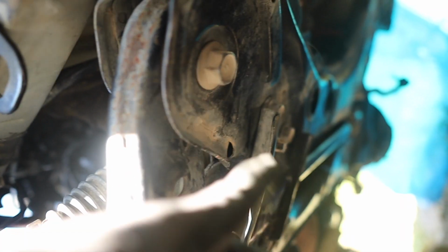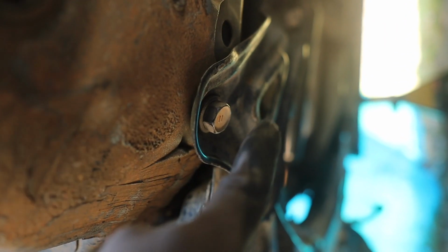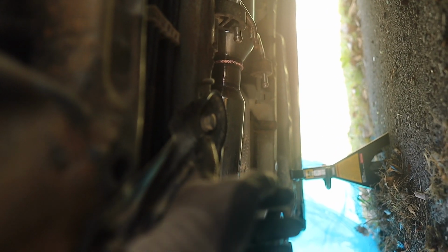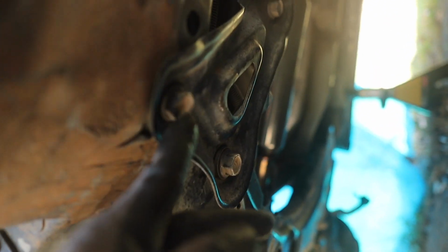These are 3 bolts. They're next to the ones that I was telling you, the 4. We're not going to take the control arm. We don't need to do that. That's just extra work for you. We're going to take these bolts. So there's 3. One right here that connects us to the actual car or the frame of the car. The one to the subframe, and another one to the other side of the car, or to the frame technically. So you got 3. These are size 19.